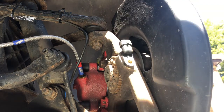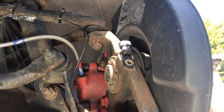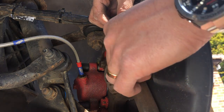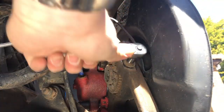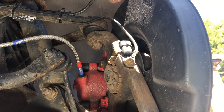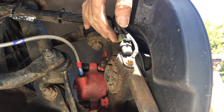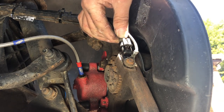Just a quick reminder: if you've got anything later than my car - this is a '96, I had the same on a '97 - they don't seem to have this extra wire, so don't fret if yours hasn't got that. It's just an anti-interference signal damper, not strictly necessary. You only need to nip the bolt back up - it's only holding the device in place. And don't forget after all this work to reconnect the ABS sensor wire. The little green element on it is a gland that stops water getting in - important that it hasn't dropped off because the connector is facing down and water can collect in there.